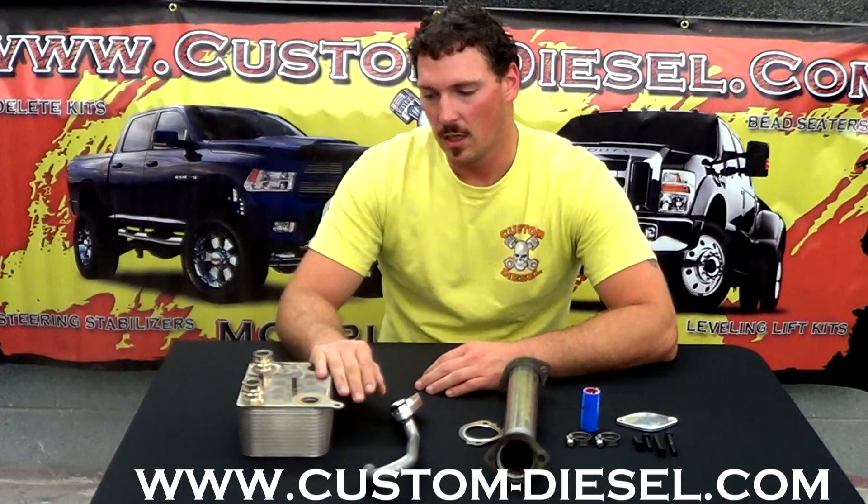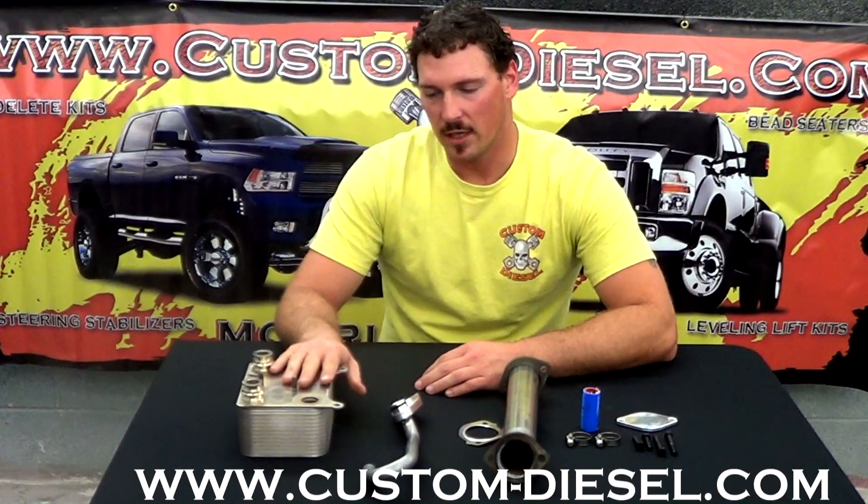All that is is when the antifreeze is breaking down and separating. As the coolant flows through this cooler, those sludge particles will become entrapped in the oil cooler. As the coolant continues to travel, you will start getting a restriction in the engine oil cooler.